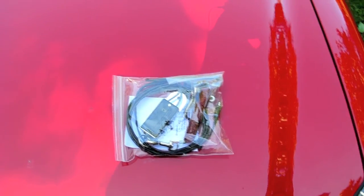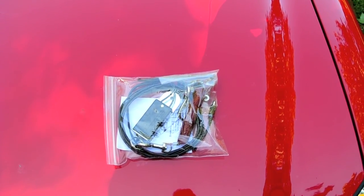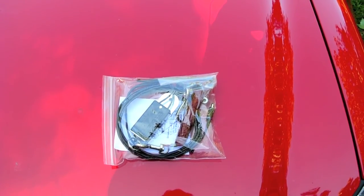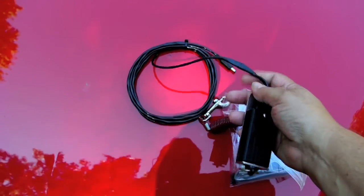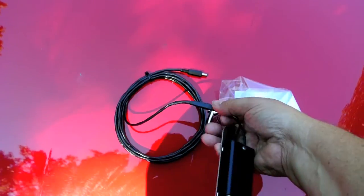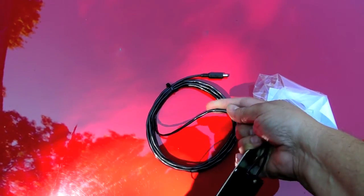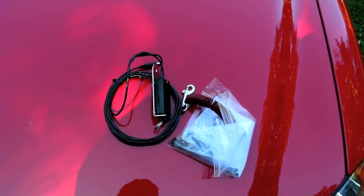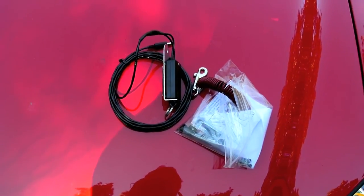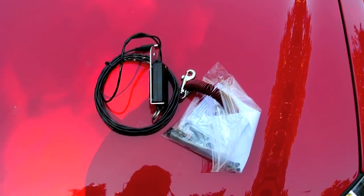If you saw my video on installing my light kit for the tail lights, I've already drilled a hole through the firewall and left a space open for this cable. When I open this up and get the switch itself out, I can clearly see where they put a splice in here and used some heat shrink. So I'm going to cut this, and after cutting it I'll have a smaller wire that I can run through the existing wiring. I'm familiar enough with electronics — I dealt with electronics professionally for 35 years — so I have no problem splicing and reconnecting.